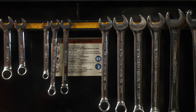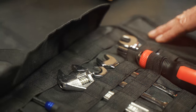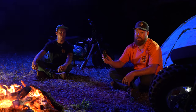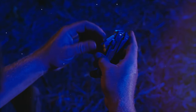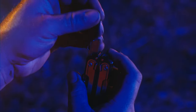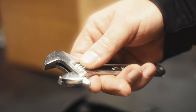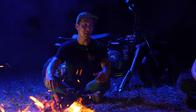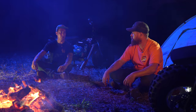For tools you want to bring with you: a lot of the hardware on these bikes is 8, 10, 12, 13, sometimes 14 millimeter, so have those wrenches with you. Allen keys — a 4, 5, and 6 — and something I always have with me is a Leatherman multi-tool. It has pliers so if your chain does pop off you can pop the master link off, put the chain back on, and put the master link back on. It's also a good idea to have a Phillips head and flat head screwdriver, which the Leatherman has, plus a knife. I also like to have a crescent wrench big enough to go over the biggest nuts on the bike — the neck bolts, axle bolts and nuts, and your jack shaft nut.